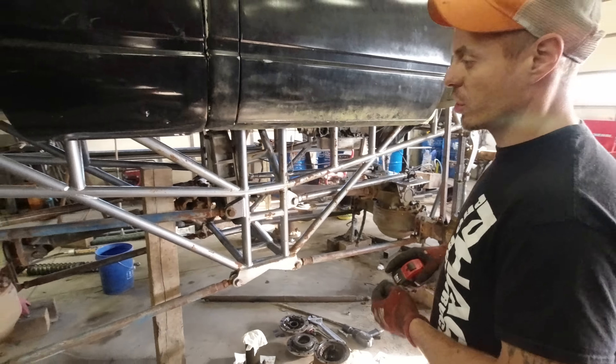Let's say 36 inches is going to be the angle of the link bar. You have to take into consideration some kind of bottom plate or tab. What a lot of guys do is bring the subframe down to 36 inches, but then this thing hangs down at least another three inches - so now you've got 39. Your bars are lower than you really want them to be. So what you've got to remember is come in here, find your level and eyeball it right in the middle of the axle. A lot of you guys are running way too much angle for your four-link bars - it doesn't need to be this way.